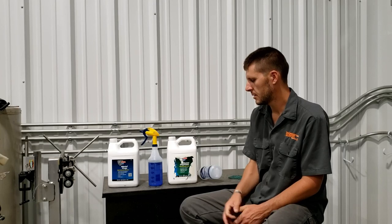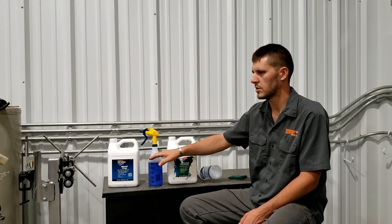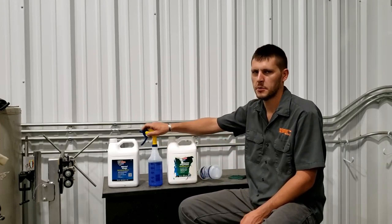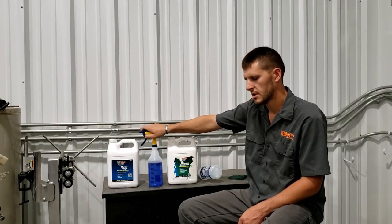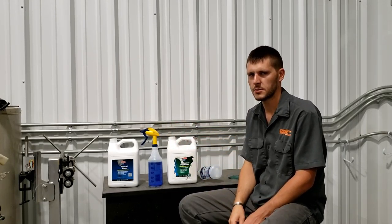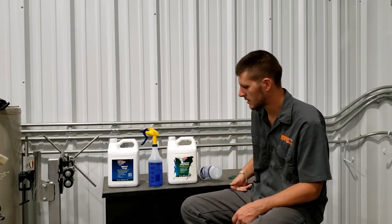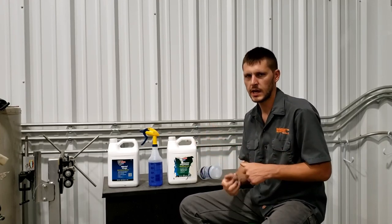So I'm not sure if that is the zinc phosphate that's left behind or if that's surface rust. But if you read the POR-15 paint instructions, it says, well, yeah, you're washing it off with water. It's going to spot rust or flash rust, and that's fine because the POR-15 will adhere to that. Well, I really don't know how I feel about it. If it's the zinc phosphate that I'm seeing, then yay, you know, you have a lot of high zinc primers.